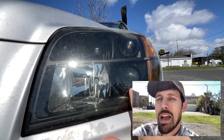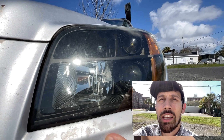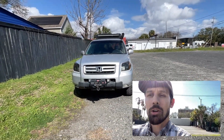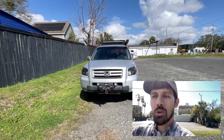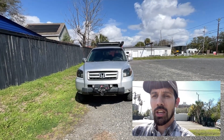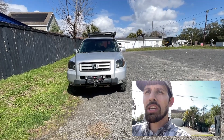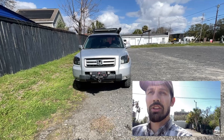The beam is not the best — there are some shadows in it. But as far as the cutoff goes, it's pretty good. I've driven with the Pilot behind me in my Civic and it's not blinding me to any ridiculous degree. The most important thing is when you upgrade your headlights to LED bulbs, you've got to consider refocusing and retuning your headlights, making sure they're pointing at the right height. You might need to lower them a little bit. For me, the cutoff has always been pretty good, so I've not had to adjust it very much at all.